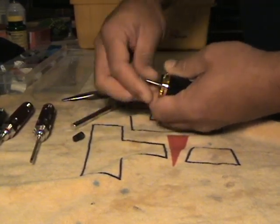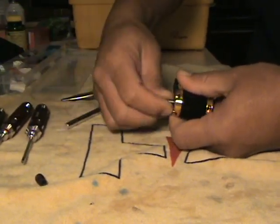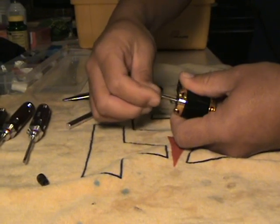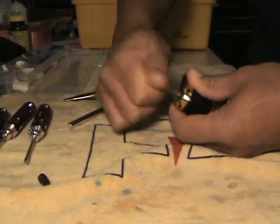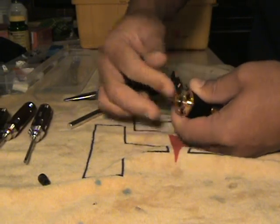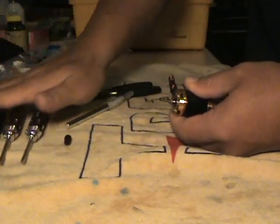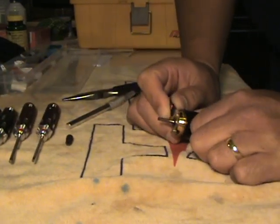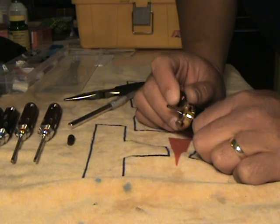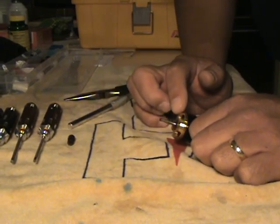Just like that. The new pinions will generally go on a little bit, or a lot, easier than they come off — they usually go on by hand. As you can see, the pinion came off easily in little increments as you use the bigger tools. And doing it this way makes it so you do not damage the pinion, the shaft, or the case of the motor.